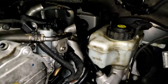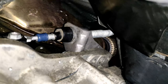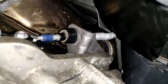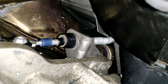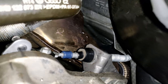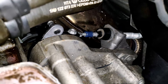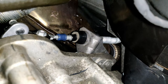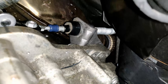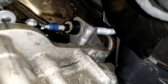I spent a decent amount of time on this transmission shift lever cable. Down here there was a lock washer — getting that off took a little time and required a couple different types of pliers, and eventually a flat head and a chisel. You kind of have to peel it off with decent force. There was also a little lock washer at the peg that wasn't difficult at all, and then you can just pull the cable off to the side. The metal bracket is all the way around the cable, so I'm guessing I can get those mounting bolts out as the transmission comes down.